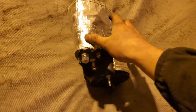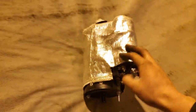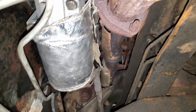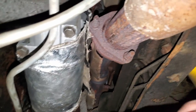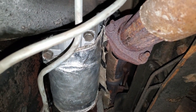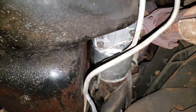There's the new one that's going in. I've got the heat wrap heat shield installed — cut it so that I can still get to the solenoid. Let's put it in. I got the new starter in, all tucked in there, complete with the heat shield and everything. Hopefully this one won't suffer from the heat soak issue, because look how close the exhaust is to the starter — it gets really hot and burns it up. I'll clear out my stuff and we'll test it out.